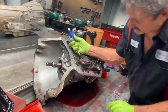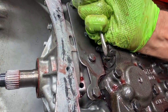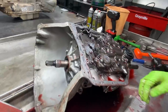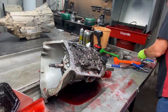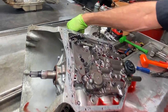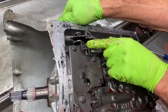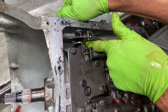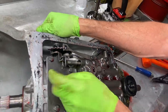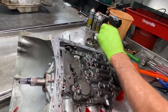You can see here two stages on this valve - real floppy, and it gets hard, and now it's got a hard spring right there through that little area. And then we have all of our parking stuff here and detent levers. You want to make sure this is bent far enough this way where this can't fall out. Always check this nut down here and tighten it, because these are really bad about coming loose, causing all kinds of shifter issues and this little S-shaped clip falling out. So you always want to check that.